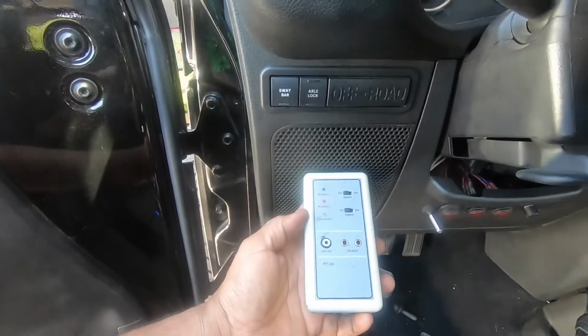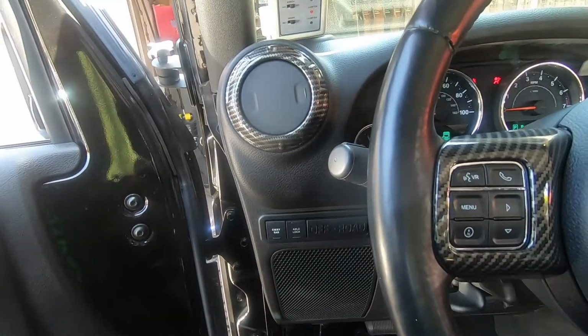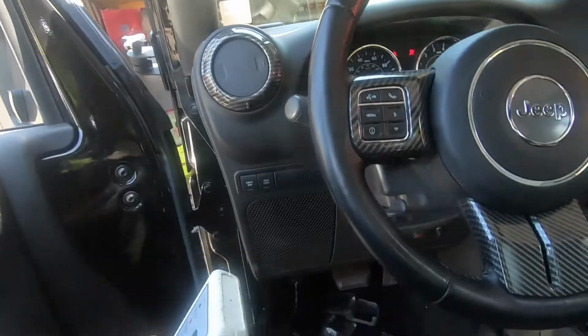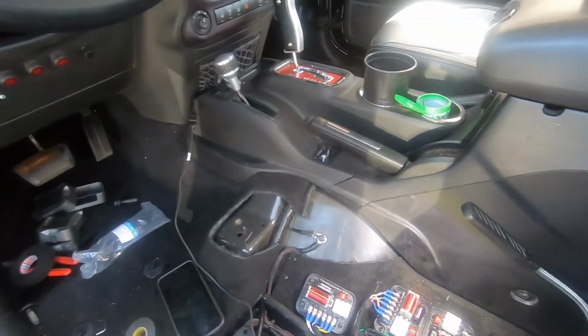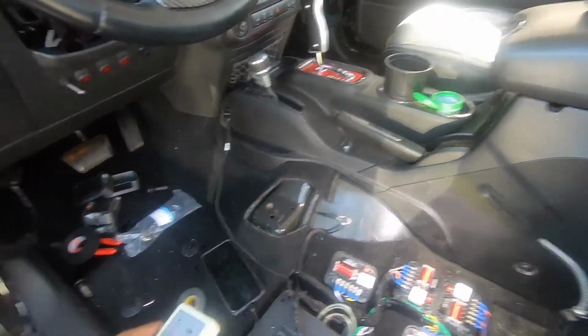So left front is out of phase, the driver is. Tweeter is as well. So I know which ones are which. So we got the right front crossover here. We just gotta make some changes on the crossover. So we'll make changes and check every speaker, and then I'll show you how we check it, okay? All right, stay tuned.